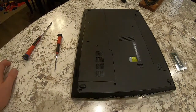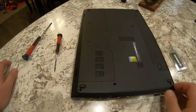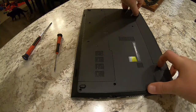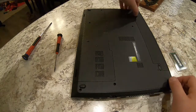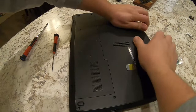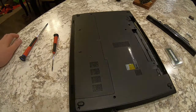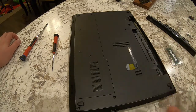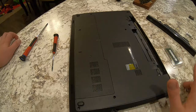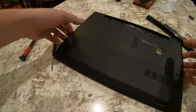The first thing you're going to do is make sure it's unplugged from the wall — you do not want any power coming in. You're also going to want to remove your battery. Depending on your laptop this could be different; usually there's a little unlock tab here and an unlock tab here — one sticks in place and the other you hold in place. I'm not a super techy guy, I'm a hands-on guy, so this is semi-new to me as far as working on small electronics, but it is not difficult.